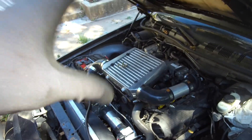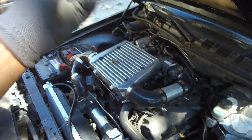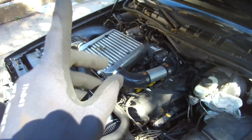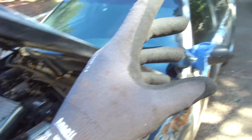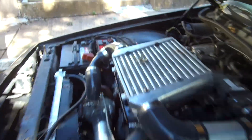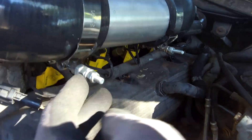So another video — I'm going to run it hot and see how it works. I don't think it works real well in a real humid situation. I still think I need that air-to-water intercooler type deal that you guys are talking about. I've seen one that kind of looks like this, so I'll probably be getting that and running some cooling lines with a cooling tank in the back. You can see it's doing something, so this will definitely work. And I had starting problems with it too — this blew off because this thing here got stripped. I put two bolts underneath there and kind of just got it going. Now it starts up pretty well.